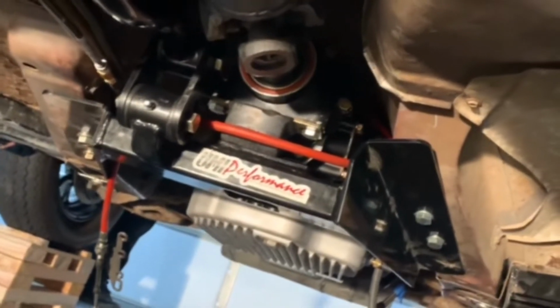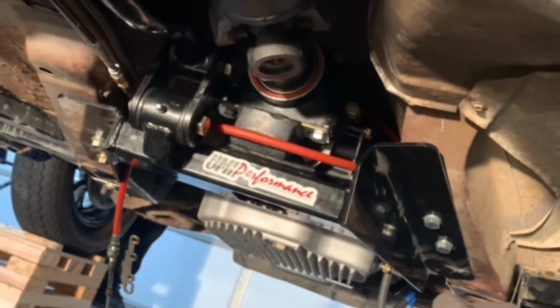All right, everything put back together, sort of torqued, tightened. The only thing left to do down here, transmission wise, is hook up the shifter linkage and swap the gate plate and plug the temp sensor in, but I want to wire that differently, because it's got just so much slack right now, it just kind of flops around and it can get burnt up. Wire up the trans brake and then blow out cooler lines, and then we can just restart assembling everything, starter, and then the top end of the motor, and then see if the trans brake works. Transmission builder said it does. He tested it, so that's promising news.